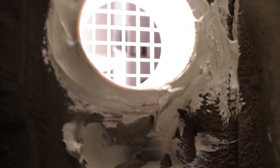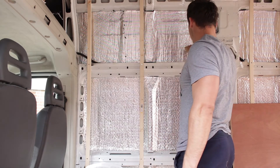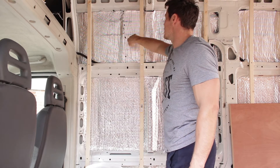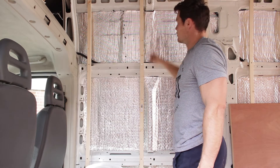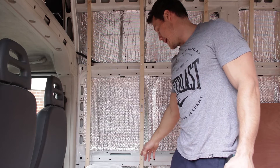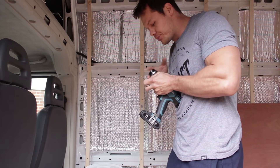Sealed all around. I'm going to cut the vent in here — I can't quite fit it in the exact spot, but above the loo is going to be just fine. I'm going to drill a little pilot hole to give myself the right distance, then cut it out from the outside. The great thing is it doesn't need to be sealed like the toilet — the vent itself fills the hole, so that's good.